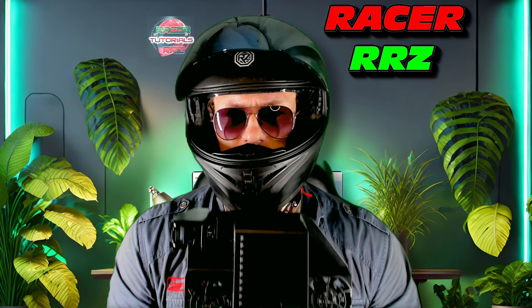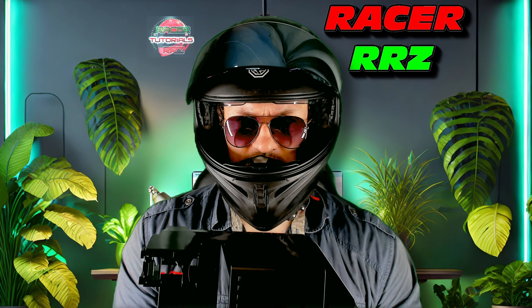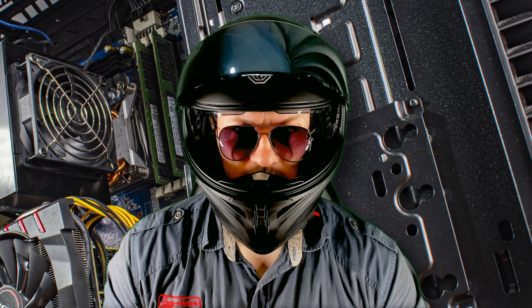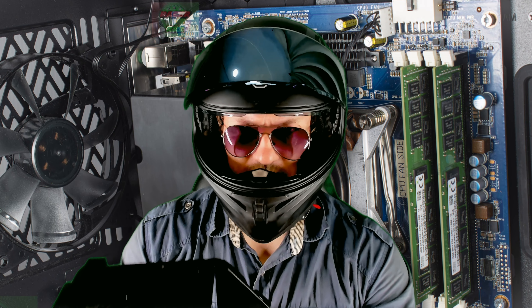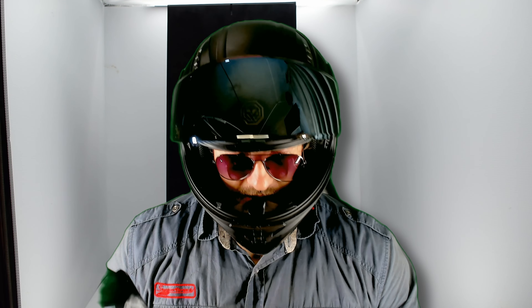Here's a slight side project. This is the HP Z440 memory shroud. If you're familiar with that system, you may know that in order to run eight memory modules, we need to run this particular piece — because there's a little six-pin power connector here. It's a very strange-looking connector, almost like a GPU six pin but a mini version. Without this, you run into some trouble. There are some videos out there showing how to bypass this issue, but I'm hoping to find a slightly better fix. Can we fit this, particularly if you've done an HP Z440 case swap — which I have? Can we slot this in and maybe get it working on a case swap to allow eight modules without any problems? Why run eight RAM modules on a Z440? Well, it's ideal if it's a server — that's exactly what I'm using mine for. Stay tuned, future videos will go through that and so much more.